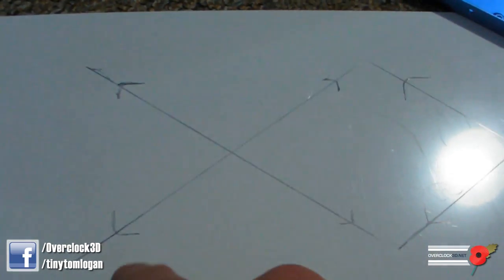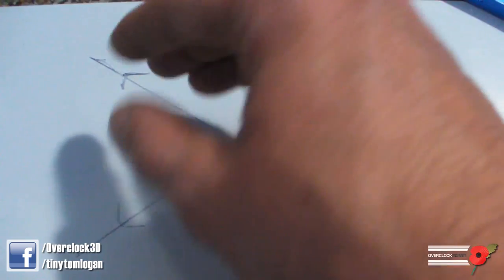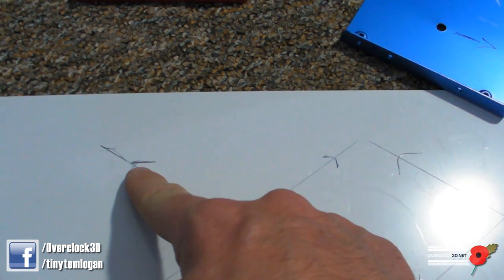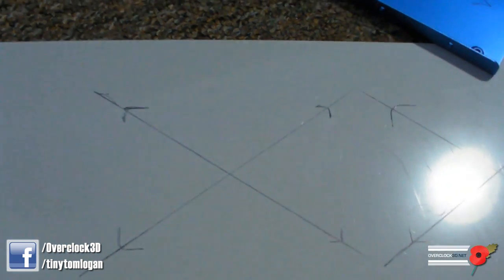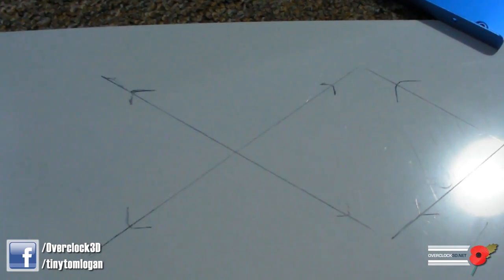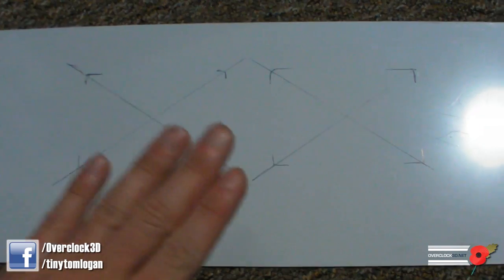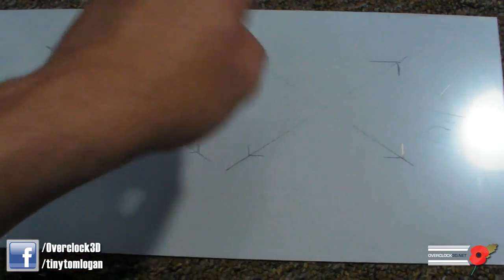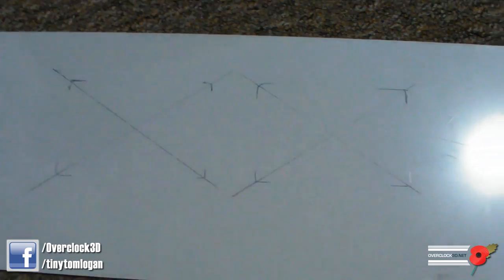When you do your drilling, a little tip: don't just start drilling straight away. Get a drill bit or a centre punch — that's the best way to do it, but most people won't have a centre punch. Get a drill bit, line it up, hold it in the right place and tap the top with a hammer. The point on the end will give you a nice start so when you drill it won't race all over the place — that little tap will make sure you get your holes in the right place. I'm going to mark it all up, get the holes in, and I'll be back with the drives in the side of the case.